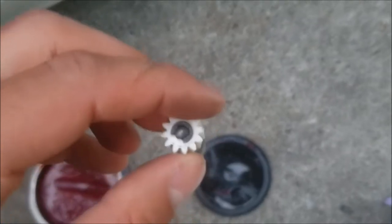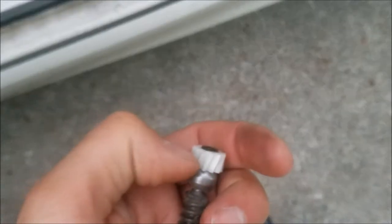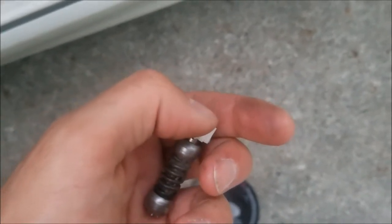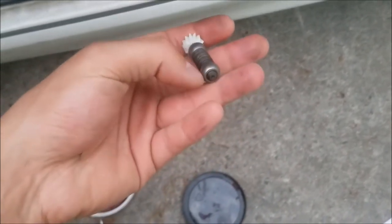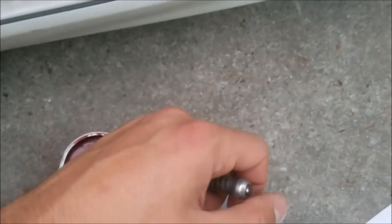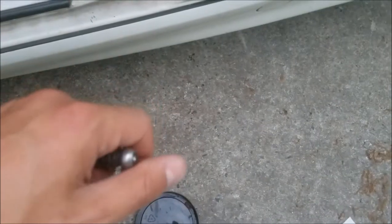I've got my new rod and my new plastic gear. When I bought this it actually came with a new rod, so I didn't have to press it on. Typically when you buy these they're not going to come with a new rod, so you have to press it on — it's really not hard to do. I just took the back side of a wrench with a rubber handle and hit the end to press it into the gear. The gear has two sides: one side has bigger holes than the other, with little flanges coming out — that's the side you want to press into.